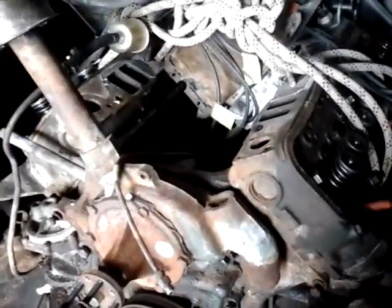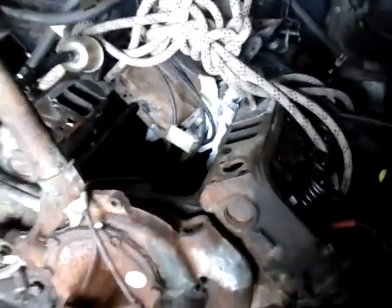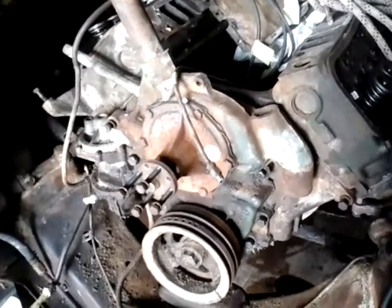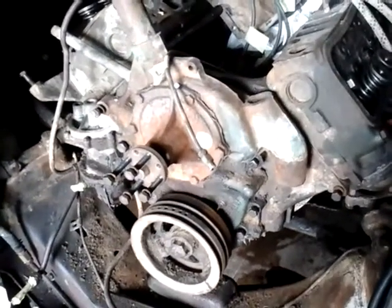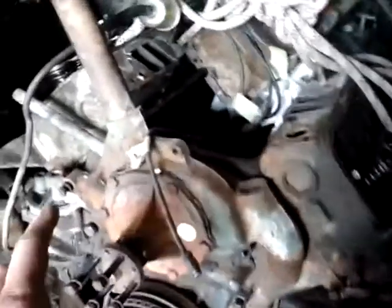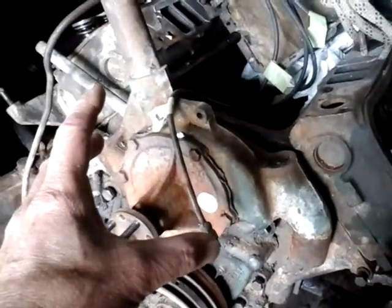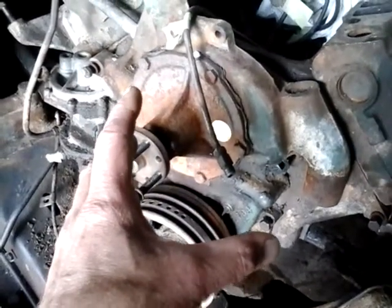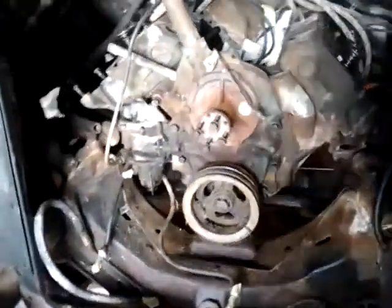They're all rounded out on the bottom. They froze solid. And the cam, which I can't show you in this light, it looks like a dog's chewed it up. So that's got to come out. I think possibly that the timing slipped, but the timing has got to come out to do the cam, but to get the front of the timing off, the motor's got to come out. So this is where I am at the minute.